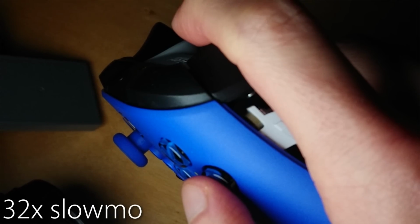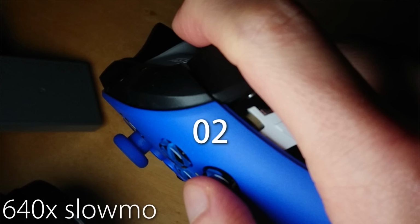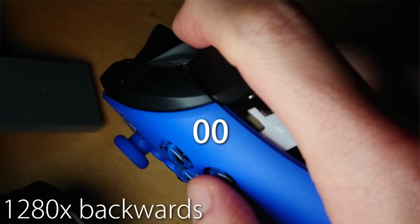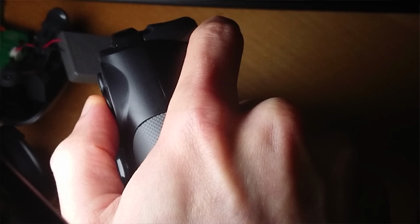So I took some video of me pressing the button on an Xbox controller. It's not that easy to see a start. If we are really lenient, it takes 12 milliseconds. But the time from where the button seriously starts moving to bottoming out is only 3 milliseconds. The travel distance on these so-called ultra-responsive buttons, which are really just mouse buttons, is only a third of that. It's so small that I wasn't really able to see when the button was pressed on a video.